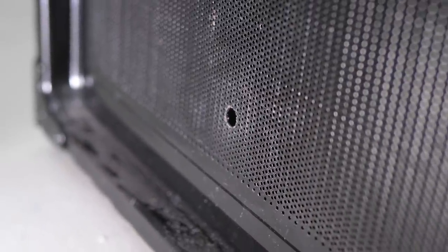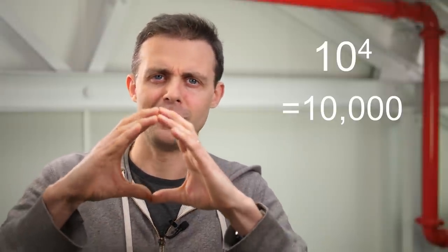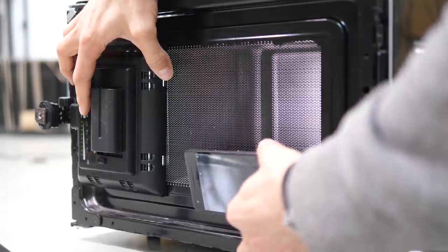Quick safety warning: modifying a microwave oven can make it dangerous. This is not for children — it's for adults only. If you're planning to modify a microwave oven, be aware that you should assess the risks for yourself; this video does not constitute a risk assessment. Suppose the holes were a centimeter in size — that's a factor of 10 compared to a wavelength of 10 centimeters, so 10 to the power of 4 is 10,000. The microwave radiation would attenuate by a factor of 10,000, which for me is fine, and it's big enough to put a camera phone in front of. If you subscribe to Cody's Lab you'll have seen a similar method; that video isn't available anymore, but Cody's Lab is an amazing channel and you should check it out.